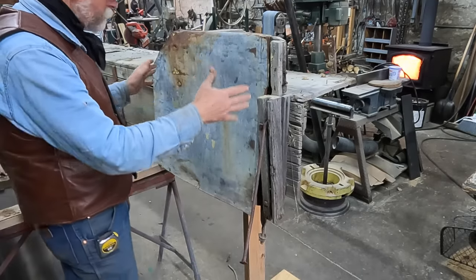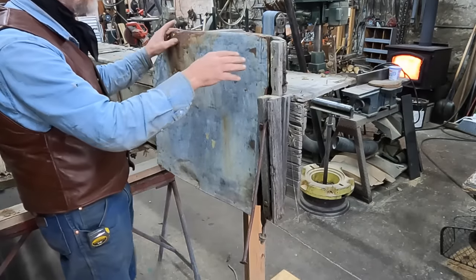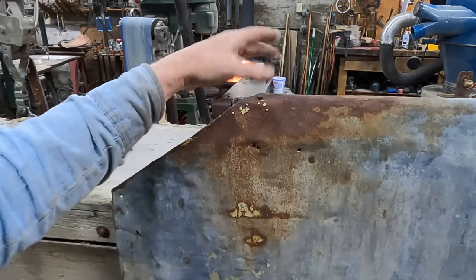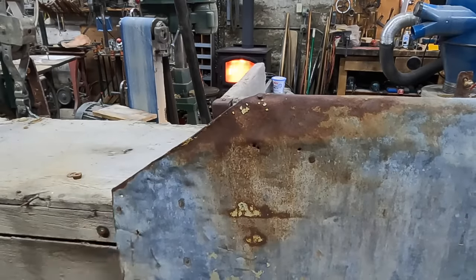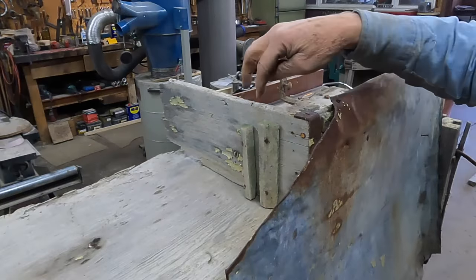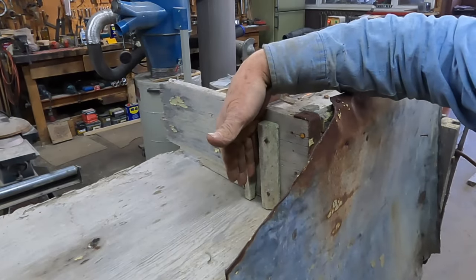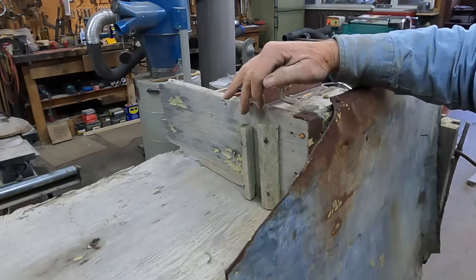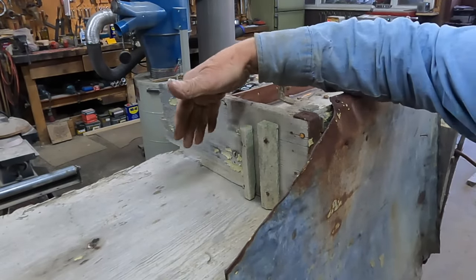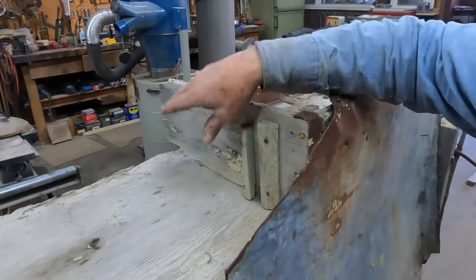The style of the tin work behind where the stove will be is unique to this wagon. Custom fit around this box here that will take the pots and pans. It has this bevel that comes from this box. It's speculation, this is where the pots and pans were. It comes down to the bench, specific to this wagon. Now we know that this is where the kitchen cabinet set. And on the side of this box where the pans would have set is a couple of cleats where evidently there was a board that slid in here that went down to the kitchen cabinet. And there's cleats on the side of that cabinet just like this to receive that. So as this wagon was going down the road in transport, going from one camp to the next, they could put stuff back in here. And just like the RVs today, it's going to keep it from rattling and falling on the floor.